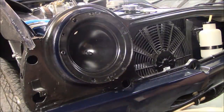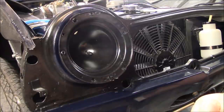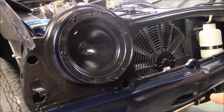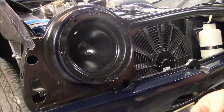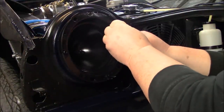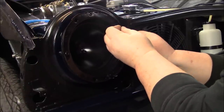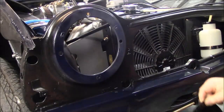Here are the new washers for the other two. Now the replacement screws, if you order them, just look like a regular metal screw — not like this type. You could use those, but if it's a concourse car, I believe these screws can be seen on the back side, so I'm not sure if a judge would nail you on those or not. You may need to get an awl to poke through the rubber because often the rubber doesn't have a through hole.